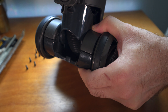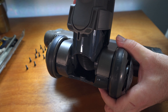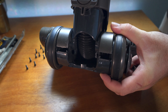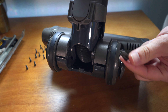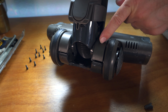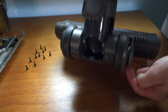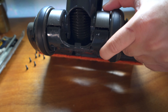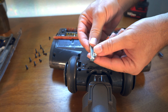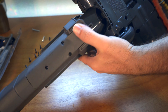The way this thing works is that the clamp between these two plastics is what gives it that function. If you look closer, as I move it you can see it goes up and down - when it gets here it wants to raise up and then go back down. So technically this would be a good candidate for gluing together, or putting some kind of brace around here that squashes this harder. That's probably the direction I'm going to go because taking the whole thing apart is probably not worth it. Looking at it now, maybe it's worth it to just drill right through the top here, because cosmetically I don't care how it looks, and functionally there's nothing in that path. Drill all the way down where it comes out the bottom, and have a long bolt that clamps this together.